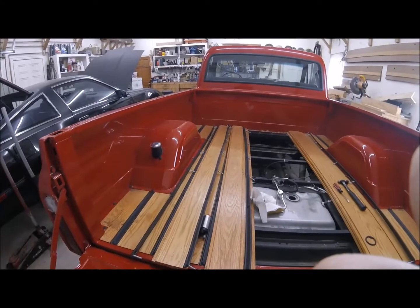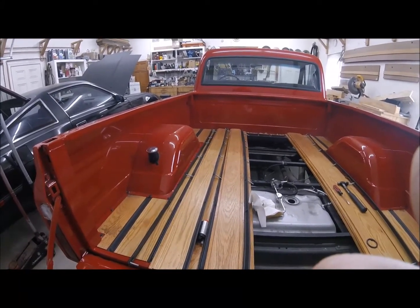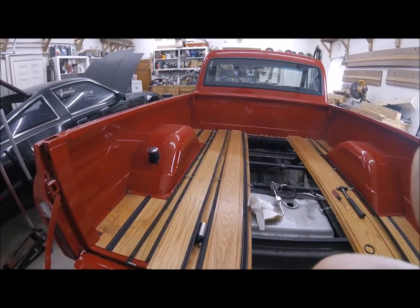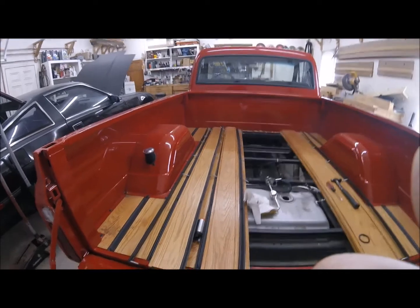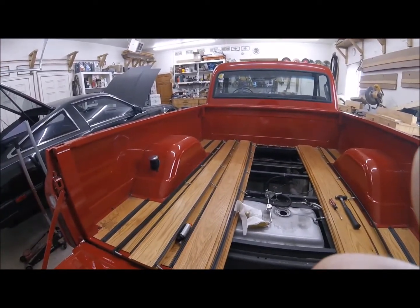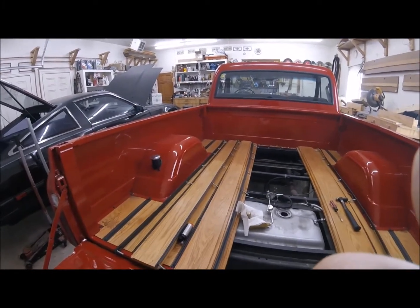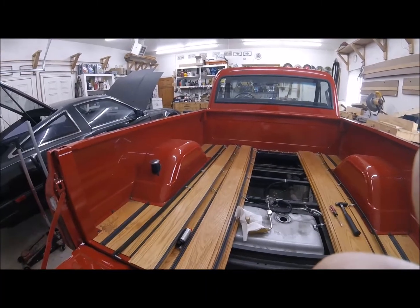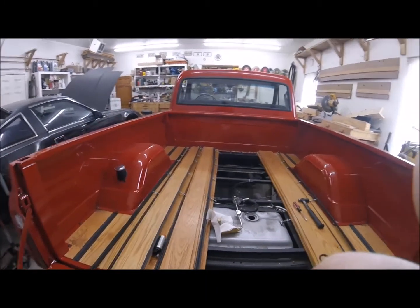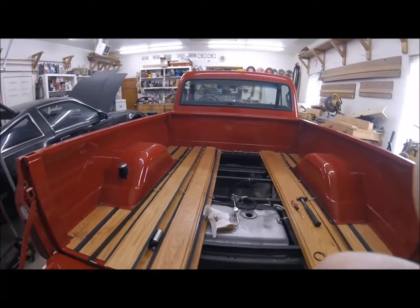And then the other problem with that fuel pump is, well, it's on its way out. I'm pretty sure it's on its way out. And pretty much all of that's due to my fault, really, because whenever we first tried to start this thing, even though I went over the instructions I don't know how many times, I still screwed it up and hooked the pump up backwards, so it was just sucking air for the first minute or two that we tried to start this thing the very first time. Although it did have some kind of kerosene in it from shipping, but still, that couldn't have been good for it.